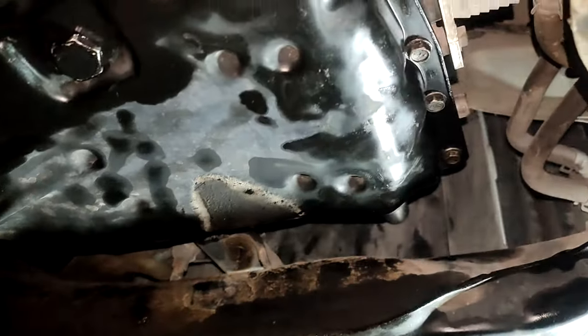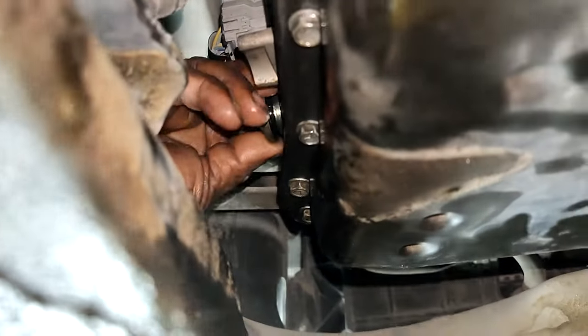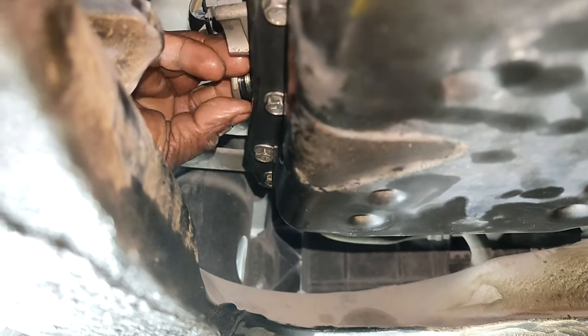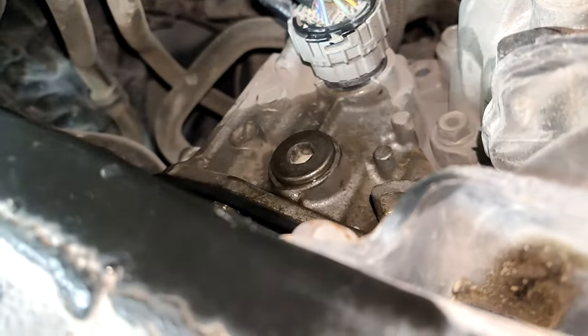Once you fill the oil, start the car and go down. There is a nut on the left side of the oil chamber — you can see this one. Once you open the nut and put the car in reverse gear, you will check the oil level here. See — the oil is coming out once we open the nut. When the oil drips out it means the level is correct. Tighten back the screw valve. This nut is called the oil stem — I'm showing it clearly. You can find it on the left side of the oil chamber, below the connector cable.